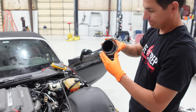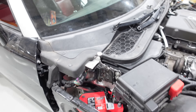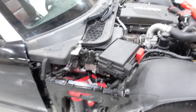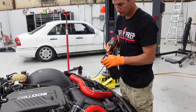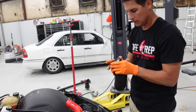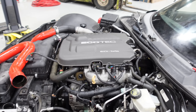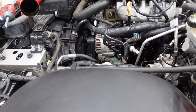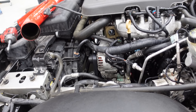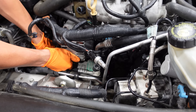Apparently so different that no one this side of Denver carries it. There was one in the Midwest, and Denver apparently is going to be the Midwest — so thanks for coming through, Denver. Battery disconnected, and Gabe already pulled the charge pipes. Two clamps, three clamps, just about done there. We just need to pop the belt loose and three bolts, and we should have that thing out of there. One minute has elapsed.